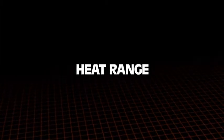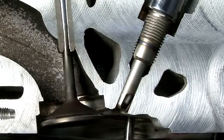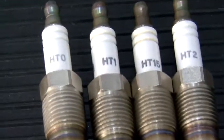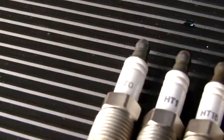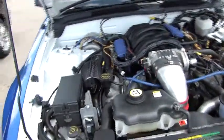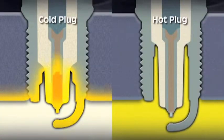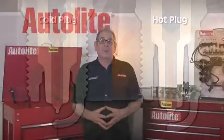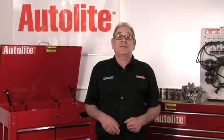There are a handful of manufacturers with spark plugs for these engines, but Autolite offers the correct variety of heat ranges and a plug design that exactly meets the OE design. That's important since the engine manufacturer specifies four different heat ranges for this engine and only Autolite offers all four. There's even a special HT0 plug for owners who may have modified their engine — it's a colder heat range plug that's ideal for supercharged or modified V8s. Remember that heat range is the measure of how quickly the spark plug dissipates combustion heat. Installing a spark plug with the correct heat range is important: it has to be cold enough to avoid pre-ignition, but hot enough to burn off combustion deposits that could collect on the spark plug tip. And keep in mind that regardless of which spark plug brand is installed in this engine, the procedure we've outlined here is the only approved method of high thread spark plug removal.